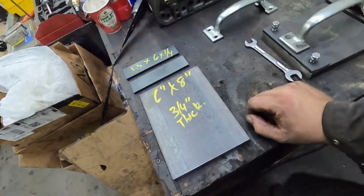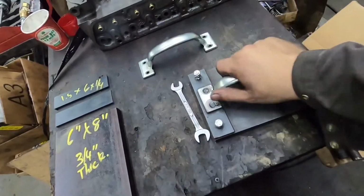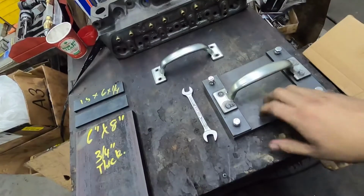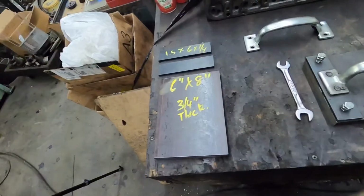And you don't want to push on the block. You could do it after you put it together. You literally just want to hold on it and then just glide it back and forth, because you don't want to put weight input into it, just the weight of itself. Obviously best if you can have it either surface ground or something like that.